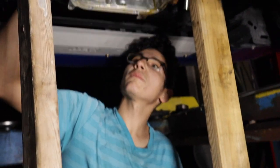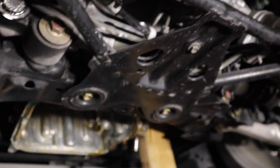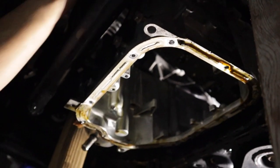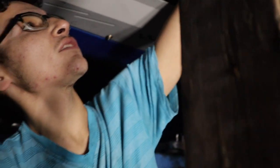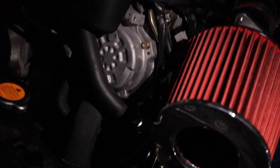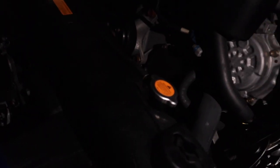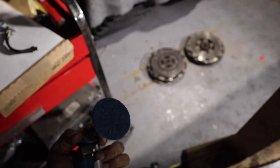We're not able to get the motor all the way up to slide the pan out, so we got it high enough to clean it up, change the gaskets, put fresh RTV, then put the pan back on and lower the motor back in place. The motor is up pretty high — it's sketchy. Don't do this, guys — just take off your subframe. The Z gods came through and I was luckily able to get that broken bolt out. I've got a tool to clean up all the excess RTV, get it nice and clean, then put fresh RTV in and throw the pan back on.